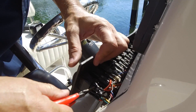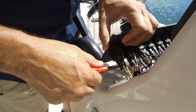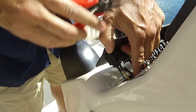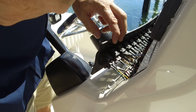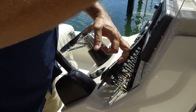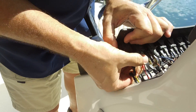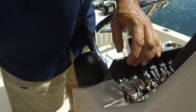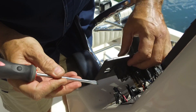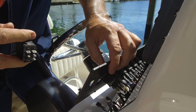Now we're going to go ahead and disconnect all the wires. We'll take the power and the grounds off the tops, then the power and the ground off the bottoms, and that's going to leave our trim tabs. I'm going to take another picture with just the trim tab wires exposed, then we're going to take off the green and the yellow — that's one trim tab — and the red and the blue, that's the other trim tab. On these particular switches, they're held into the panel by little tabs. Press those tabs in and push them to the back, and the switch just pops out. Same tabs are on the bottom — press from the top and the bottom, and pull the switches out.